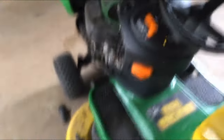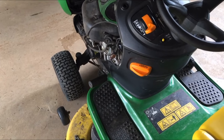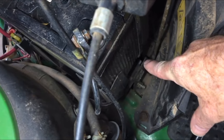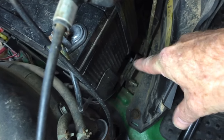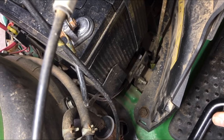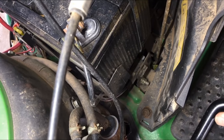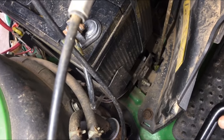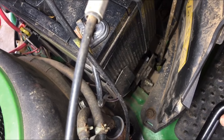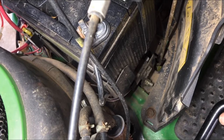The third one is on the brake pedal down there, and the brake pedal has to be all the way in for it to crank. Right down in there is a little gray thing - that's the button on the end of the micro switch, and as the brake pedal comes down it presses that switch. It's pretty hard to press with my hand but it seems to be clicking okay. I don't think that's the problem - I could pull the switch out and put a multimeter on it to check continuity, but it's not seeming like that would be a problem.